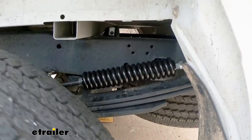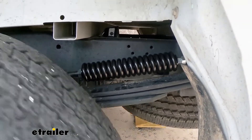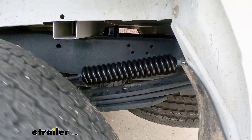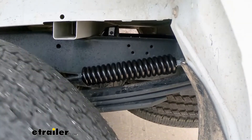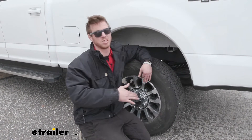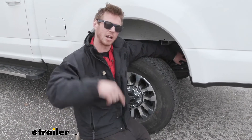Wow, I can definitely tell a difference. My truck is typically not happy with this much weight, but it just feels tighter - the suspension is doing more sooner, so I don't hit those overloaded springs at the bottom, because that's when you can really start messing stuff up. If you overload them too much your leaf springs will not work as well anymore. If you're looking for the easiest way to beef up your suspension but also have some adjustability, the Roadmaster Suspension Enhancement System is going to be great for any type of truck. These are definitely something I would use. Again, this was the Roadmaster Suspension Enhancement Kit and I'm Adam with eTrailer.